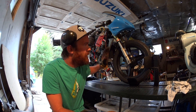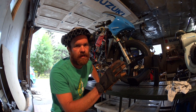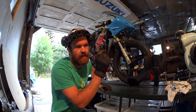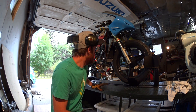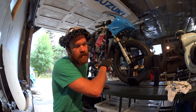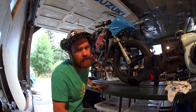Welcome back to the garage. We have a one hour window today to make some noise. I've switched out the needle to a slightly thinner one, and I've also sanded it a bit at the straight section. We'll see if it runs, if the flat spot down low is gone. And if it is, we'll start playing with the ignition and see if we can get some serious power here.